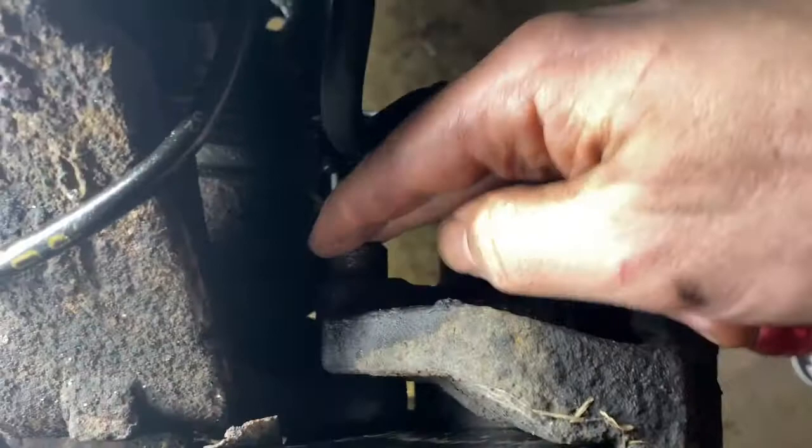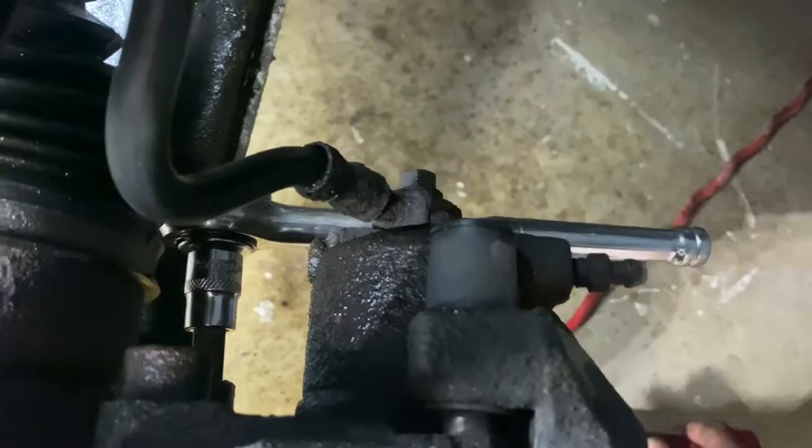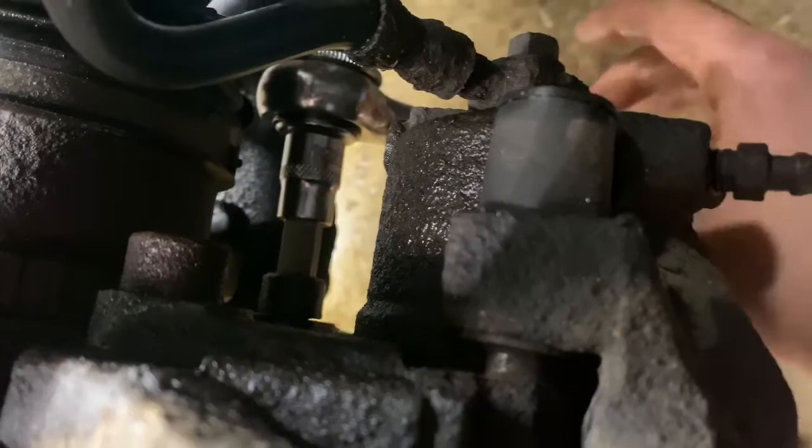If I'm a little winded, it's because these caliper bolts right here are Allen 10mm socket — so I had to stick it in; it's so rusty I had to pound it in with a hammer. Then I used a mag weight here to break it loose, put that on the end, really got hard on it, and finally got it to break loose. You can see it's actually turning — once I break that loose it's good, I can do it by hand.